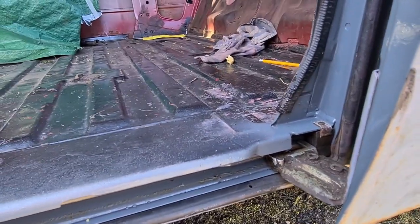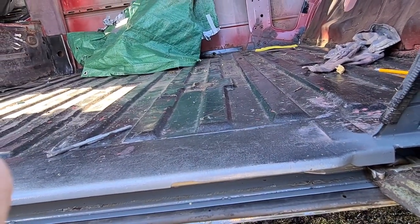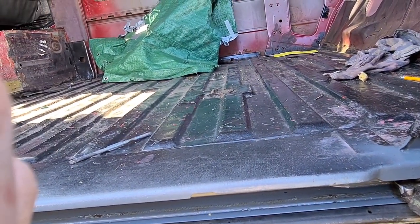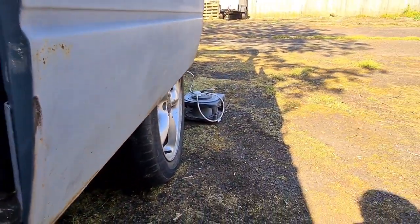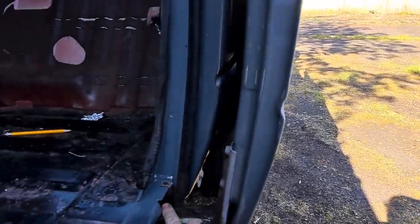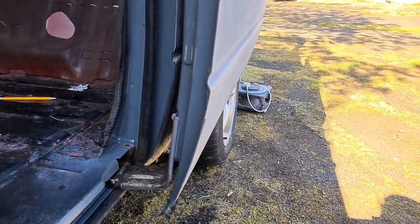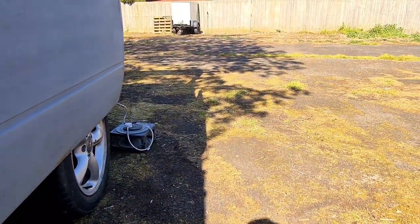So with the sliding door that way at the minute, what you need to do is you need to turn the door. Is it 90 degrees? Yeah, so you need to turn the door out like that. 90 degrees, so the rollers come out through there, and then you want to pull the door this way, and then that's the door off.